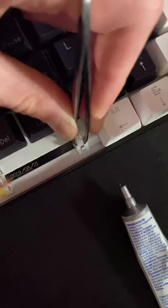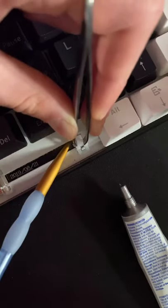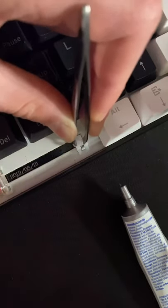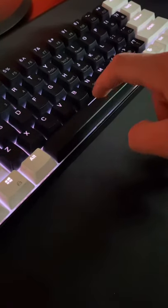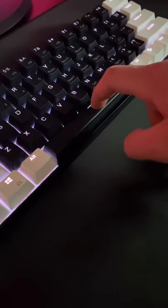Sadly, I can't slide my paintbrush underneath the metal to get the other part of the stabilizer, and that kind of makes my keyboard rattle a little bit. You repeat this process on every single key that has a stabilizer. Your keyboards might be just a little bit different, but essentially it's the same process on every single keyboard out there. That's pretty much all you can do without removing the stabilizers. Remember to subscribe and thanks for watching.